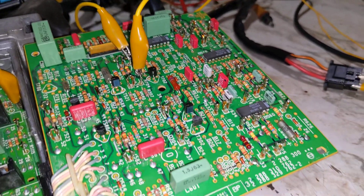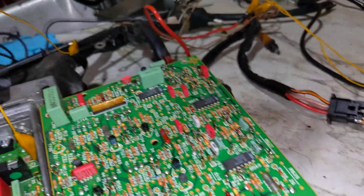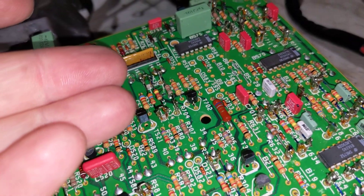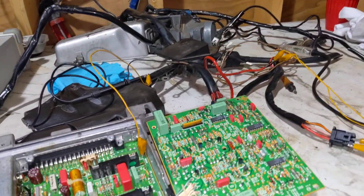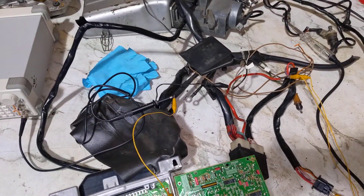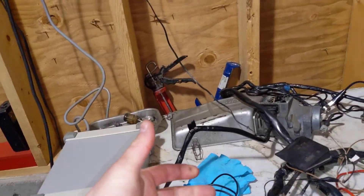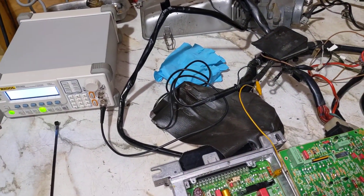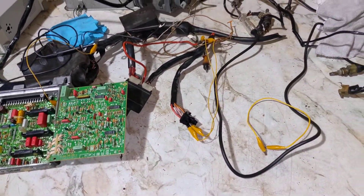All I really need to do at this point is find a suitable resistor value to put in here to bring the rev limit to what I want — about 6,300 or 6,400 RPM is what this 2.5 liter engine is supposed to be. We'll get that done, slap that one back in the car, pull the original out, and probably keep it as a spare. A little bit of hackery and R&D at Nodar Performance. Since my shoulder's broken I can't really do much of anything, so we're just going to dick around until I'm a little better. Bye for now.